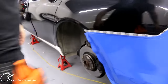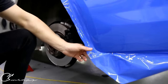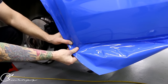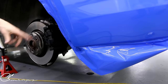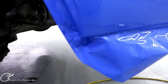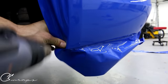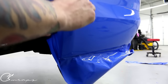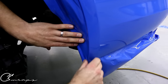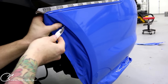Down here when we come down to do this bottom corner, what I do is a little pre-stretch — stretch it out, pull this way and this way, then down and around. When I hit this with heat — boom — it hugs itself to the inside. So all I want to do now is just make contact, lock it all in, and then we can trim.